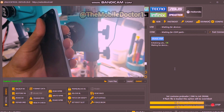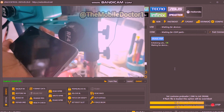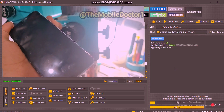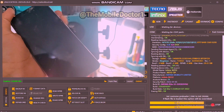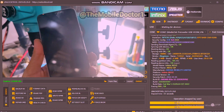When the 'Waiting for device' message pops up, you have to press both the volume down and volume up keys and then insert the USB cable. The phone will be picked up by Unlock Tool and the FRP will be removed, as you can see here.